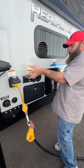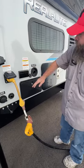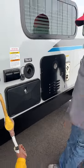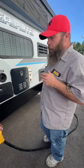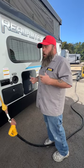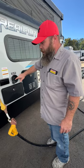Next you're going to have a 110 outlet, GFCI protected. Then you've got your fresh water fill — it's gravity fed, so you just stick your hose in and let it fill. You do want to read the monitor panel inside for when it reads full, then shut the water off. You don't want to wait for water to shoot back out, as over time that can cause damage to the exterior and inside where the hose is connected.